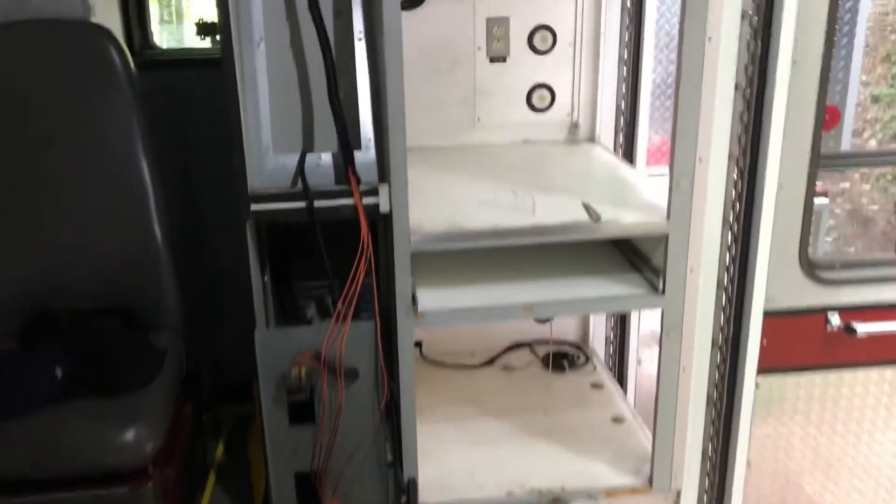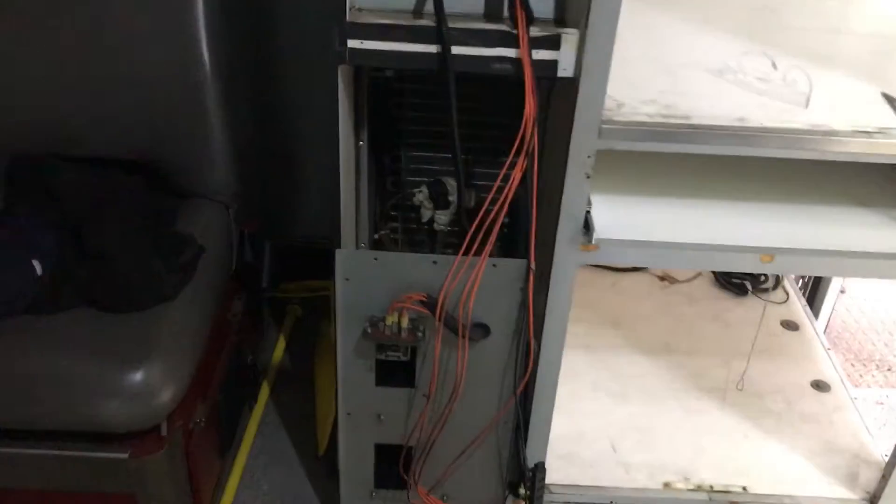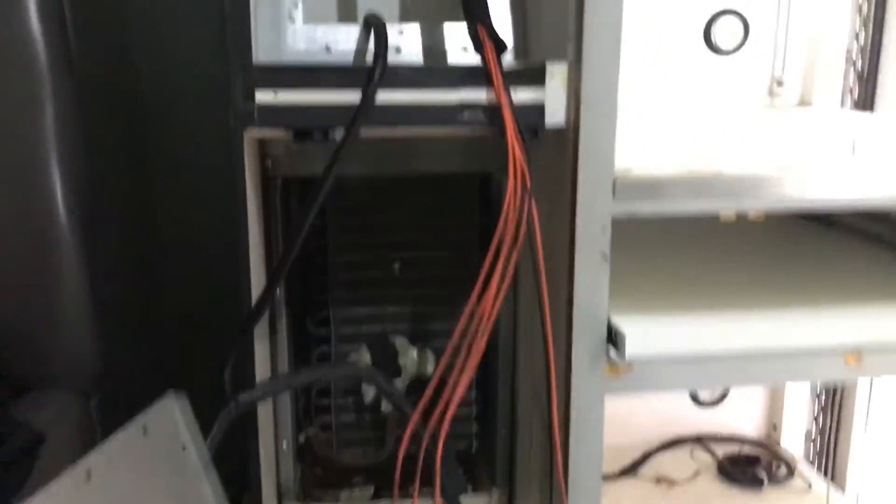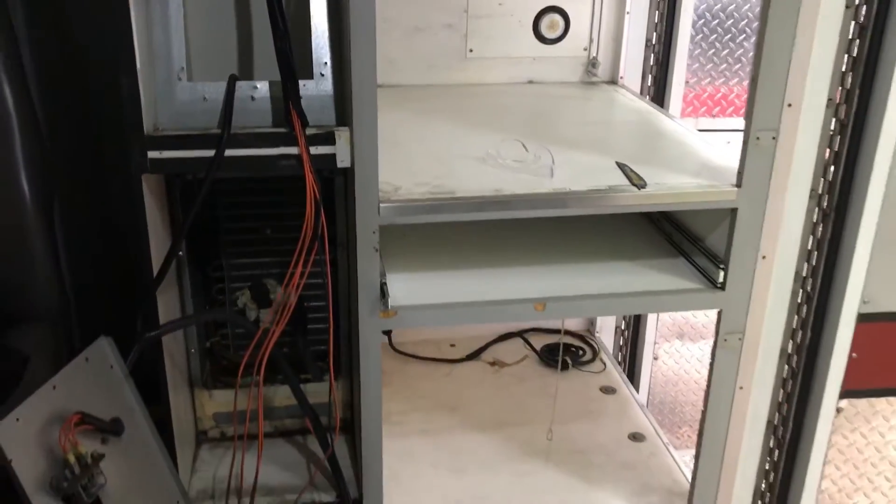I got the doors out and opened up the air conditioning system — it's not all that bad. This is the blower assembly here with some nice big 12-volt blowers. It sucked air through the front, up through the blowers, and out here. We have this great big piece right here, but I think I'll be able to cut a lot of that out and get some space. I think I'll be able to mount it behind the unit right over here and maybe vent it blowing out this way from behind it. I'm going to start cutting just piece by piece and see where I end up.